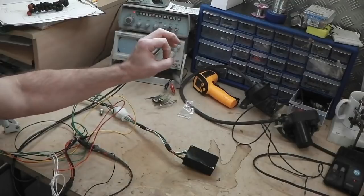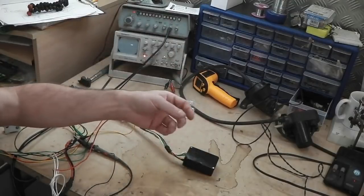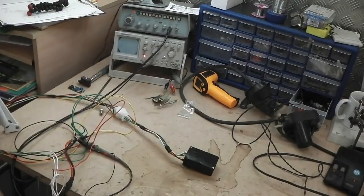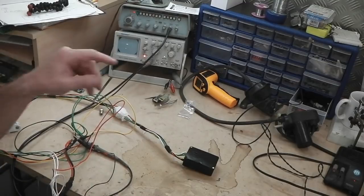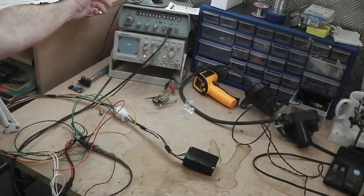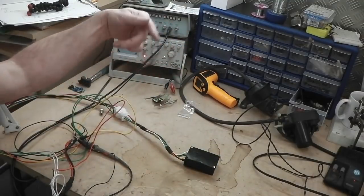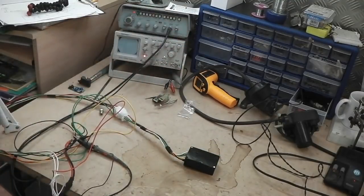We're sharing the speed sensor between cruise and this unit. You can do that. The signal's strong enough to share between different modules. You could share between your trip computer, your dashboard speedometer, your cruise control, other items that the car monitors. It may be ABS, I don't know. It can connect to various modules. The speed signal sensor on the back bolts on the back of your gearbox there. Most cars have them nowadays anyway.